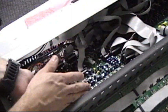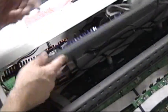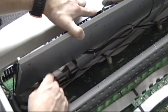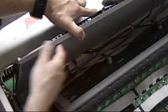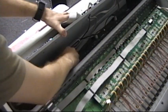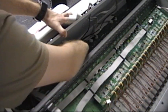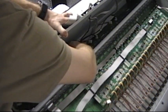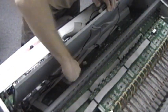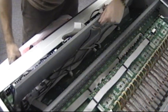At this point we need to lift up this panel by removing these screws. Once those screws are removed, we have access to the cards underneath the panel. We want to disconnect the three power connectors to the three LCD boards — these are actually called channel bar boards. Once loose, we can pull the wire through the hole and discard it.